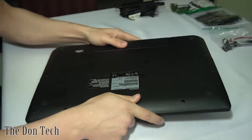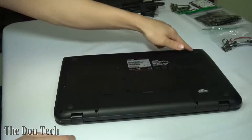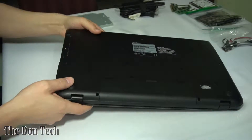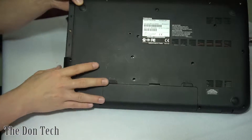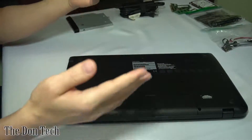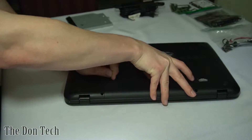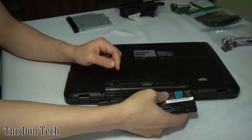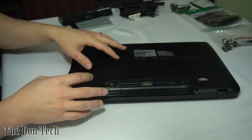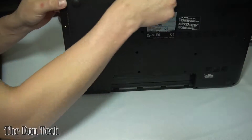To save time, I went ahead and did the disassembly already and got all the screws out of the system. This one is relatively simplistic — all the screws are the same size all the way around, nice and easy. The only one that's a little bit different is when you unlatch the DVD drive from its screw; there's another screw right there that's a slightly different size. When you have all the screws out, you pop the battery tabs, unlock it, take the battery out, and put it aside. Never work on a machine with the battery inside it.